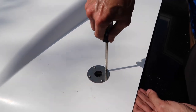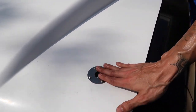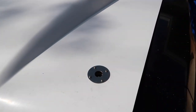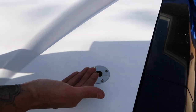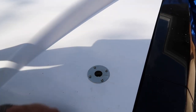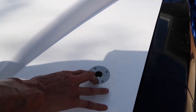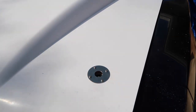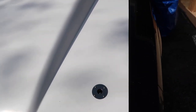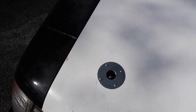These don't have to be super tight — you don't want to strip the little screw into the fiberglass, so just snug them up. They don't need to be tight; they're just holding the plate in place. What actually holds the hood from flying open is the latch and the pin, so don't strip out the screw holes in your fiberglass hood. Check that out — that one's done.